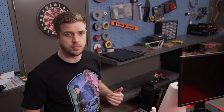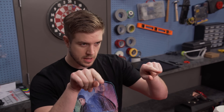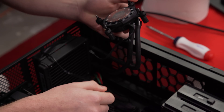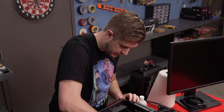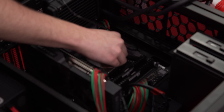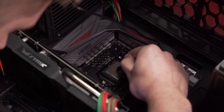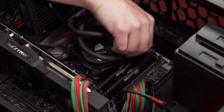Next up we're going to try the line — the next most common method. The theory with the line is that you want to go over the top of all the things under the IHS, the little metal plate. As you can see from the dot, we got a nice circular pattern that covered everything on the CPU without going too far out. After cleaning everything off with isopropyl alcohol and applying a thin line — especially important since this is really thick thermal paste — the line method also produced a temperature of 47 degrees.